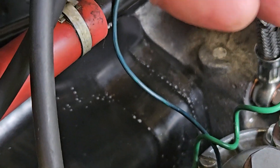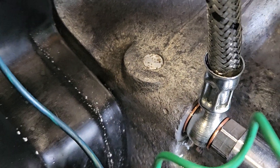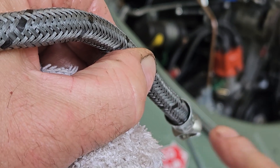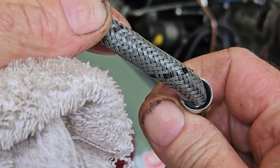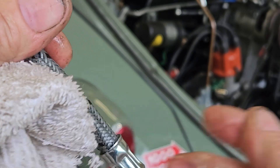It seems we have a bit of an oil leak — not good, but luckily it's quite a simple one. This pipe here has decided to give up and leak oil — it's leaking out of the bottom where it's actually crimped on, you can see it's just wet in the centre there. We're going to swap that out first. That's the oil feed pipe removed — this feeds the oil to the oil filter. It was all wet and leaking out of the crimp at the top. The crimp has just given up for whatever reason. On with the new pipe.